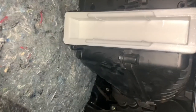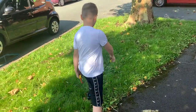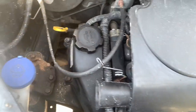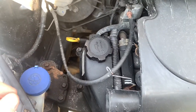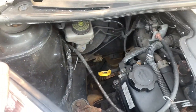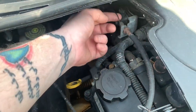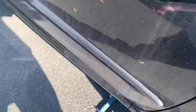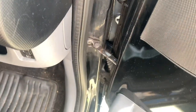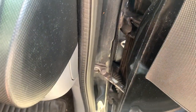The apprentice has arrived and is completely focused on the job. The car's purring away getting nice and warm so the oil will drain out nice and runny. What we'd normally also do is lubricate things — cables, door hinges, check straps. I usually use a motorcycle chain lube because it gets into the nooks and crannies, evaporates away and leaves the grease behind.